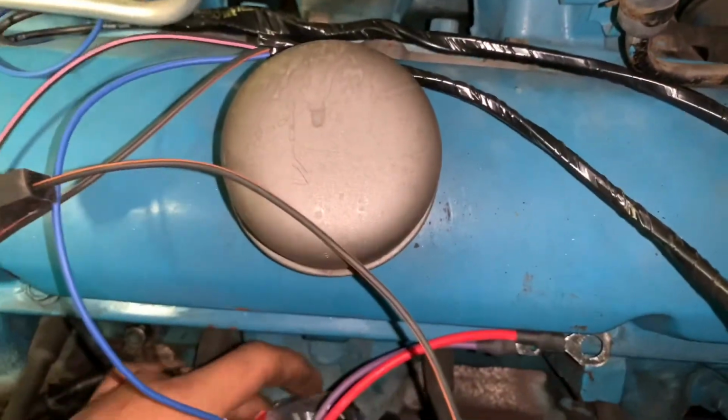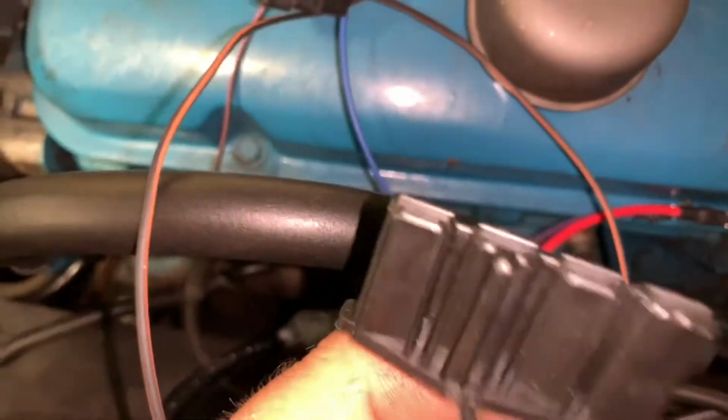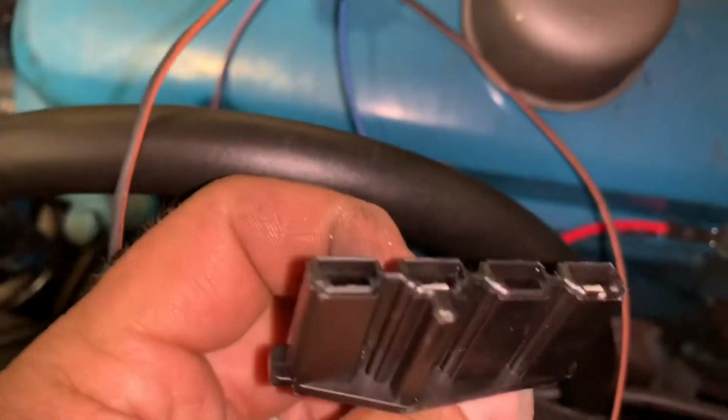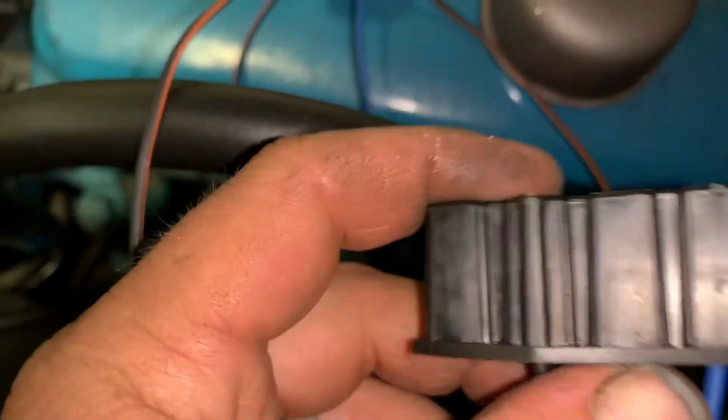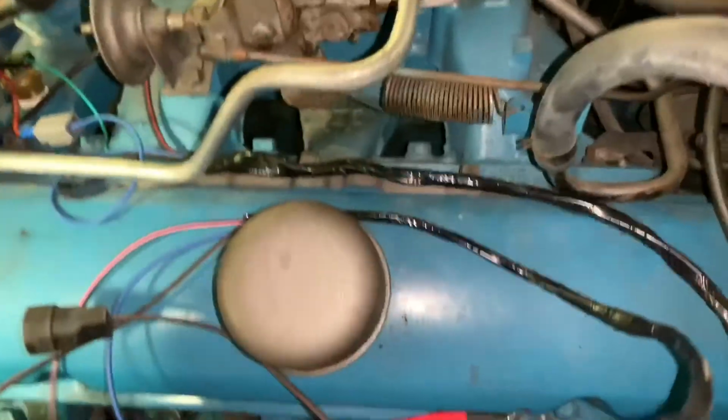These two right here. There's our main bulkhead connector. Now this is the connector for the factory voltage regulator. So what we're gonna do is we're gonna put our little jumper wire in here and then tuck this baby in there so it appears hooked up and correct where it's supposed to be. But really nothing too much on this engine bay harness.